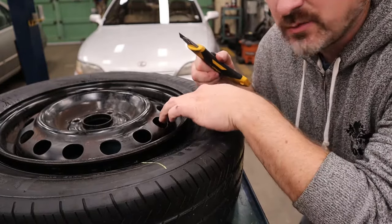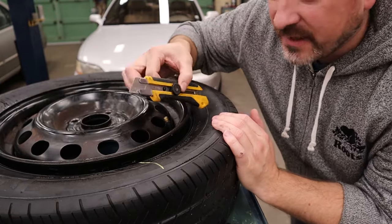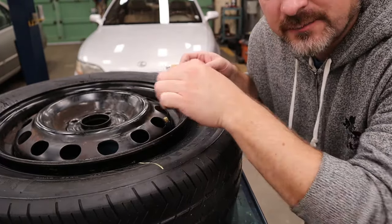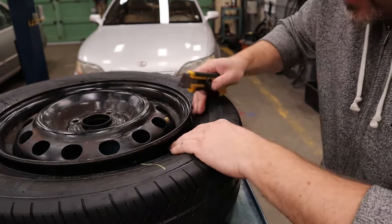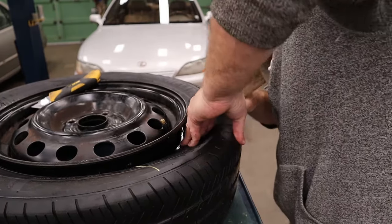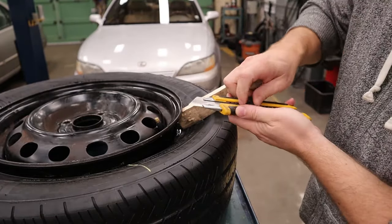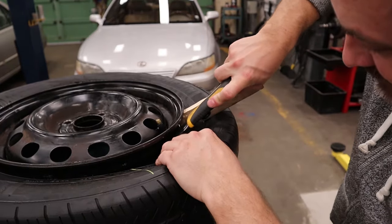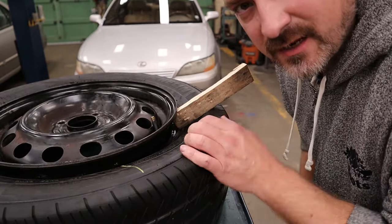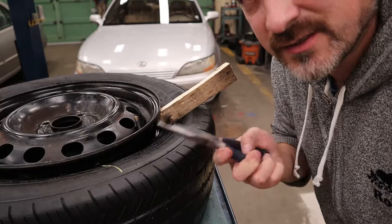In this case we just have a regular valve stem — it's old, aged out, and we're putting new tires on. Take your razor blade or box cutter, watch your fingers, never cut towards them, and cut off that little round rubber lump so the valve stem comes out. If you have trouble getting in there and need more space, push down as hard as you can and stick a chunk of wood in there to give you a little more room to work. Then take a pair of pliers and rip off that rubber so it doesn't roll around inside your tire.